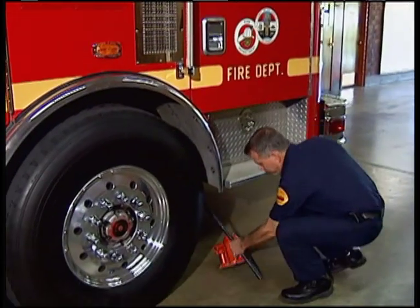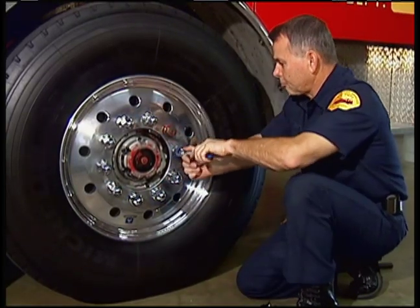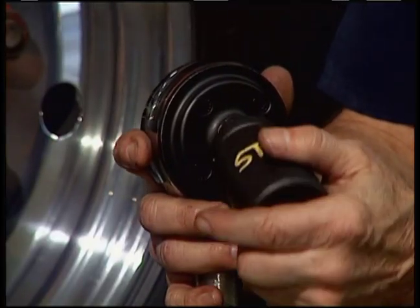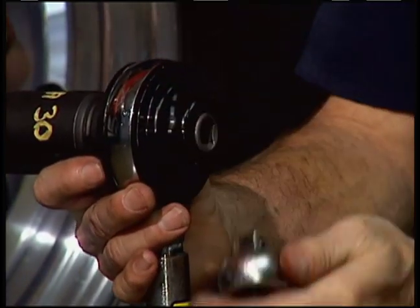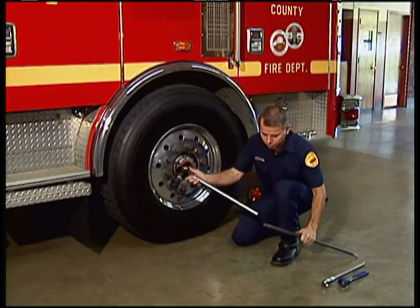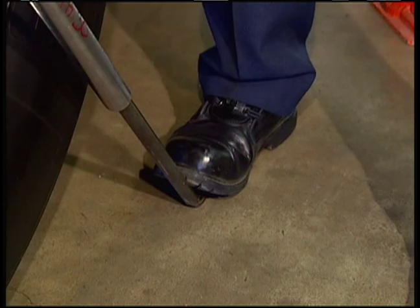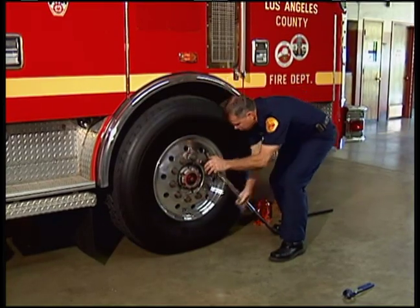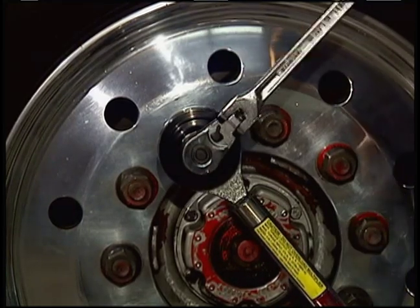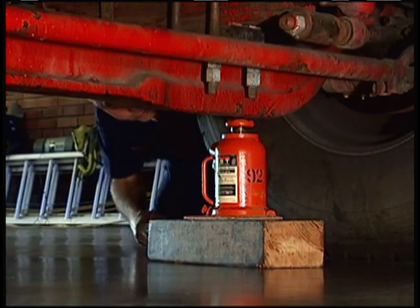Locate and retrieve the hydraulic jack. Remove nut covers with pliers. Next, connect the socket to the head of the torque multiplier, then connect the ratchet to the other side of the head. The added force of the multiplier handle should be applied to the ground. Use the extension bar and secure it with your foot. Loosen all lug nuts approximately one turn. Place the jack under a flat part of the axle nearest the damaged tire; if necessary, use cribbing to support the jack.